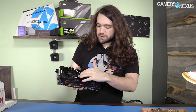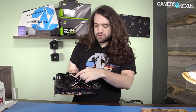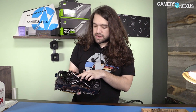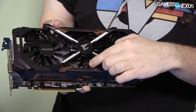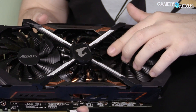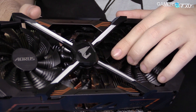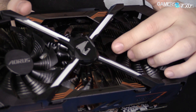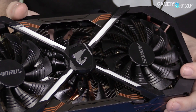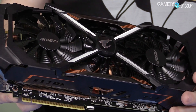Going over the basics: the three-fan design here is a WindForce cooler. The interesting thing with the fans — they're normal axial fans on the sides, and the middle one is an axial fan as well, except this blade is actually cut kind of in half. The reason it's cut in half is because the other blades come so close that if it weren't cut like that, they would collide. So theoretically, this allows Gigabyte to get an extra fan on there without making the card wider or taking up more space. How effective that is, we'll find out in testing.